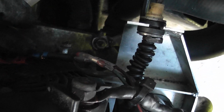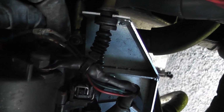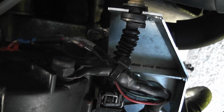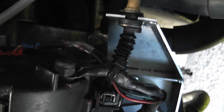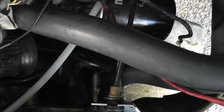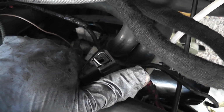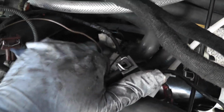Anyway, one of the other little things I had to do here, see this wire here, that's actually soldered onto one of the field windings in the alternator. The old wiring in the van used to have a signal come from the alternator to give the speed signal for the engine. That's important in this instance because there's a dynamic oil pressure switch, that oil pressure switch there, and if I decide to add a rev counter, it means the wiring is there as well. But that dynamic oil pressure switch means that if the engine's over 2000 RPM, a buzzer goes off to tell you basically stop immediately, because you're about to kill the engine.